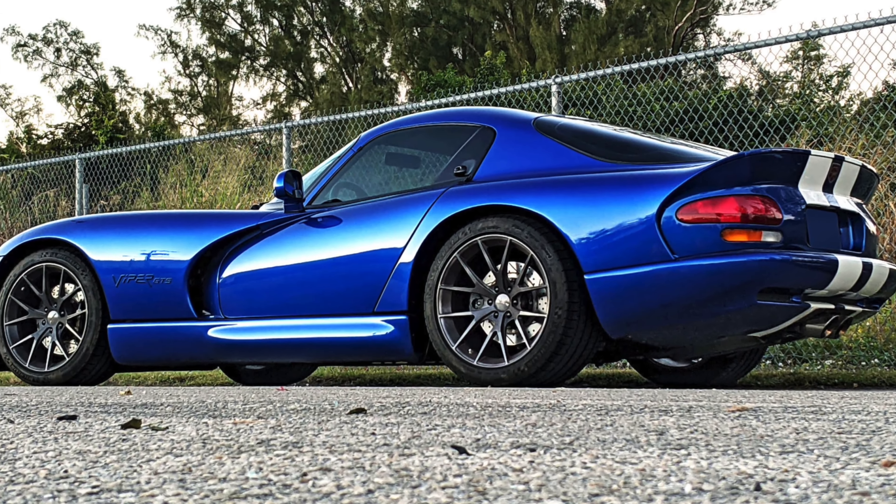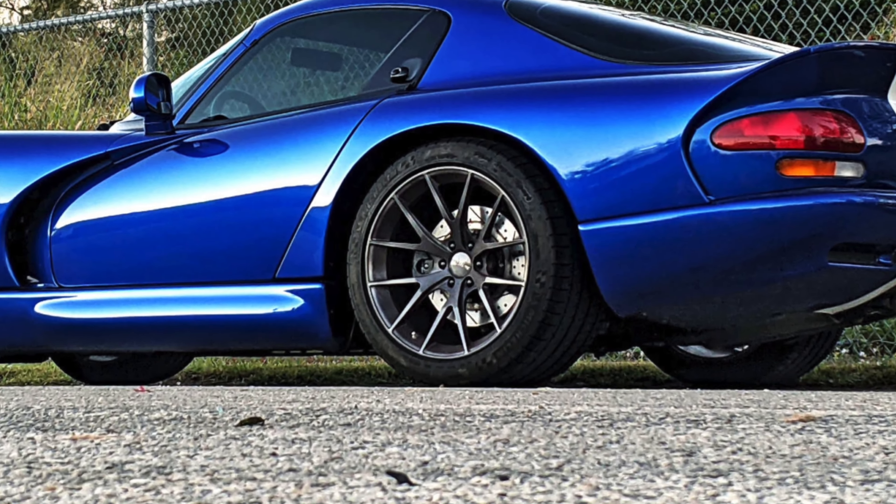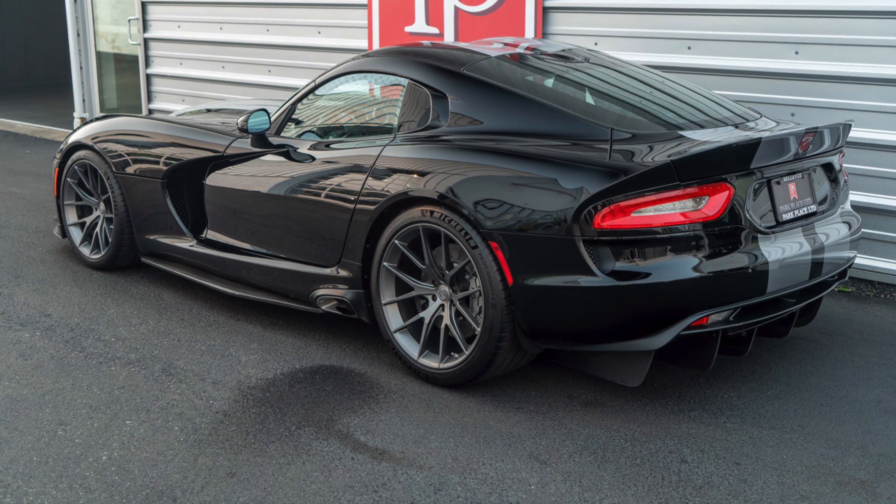Another thing you'll often see is high-performance vehicles — especially the Dodge Viper, which had a six-lug setup: six on four and a half, on a very, very small circumference. It's a pain because every time we get a Viper, the fitment is so specific. Nobody builds a wheel pre-made for it because it's such a unique car — you need custom-built wheels or something like a specific Forgestar build for that application.